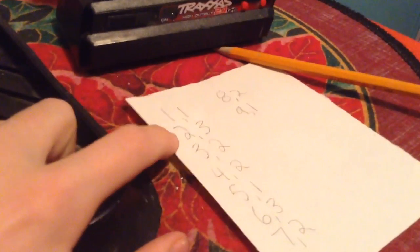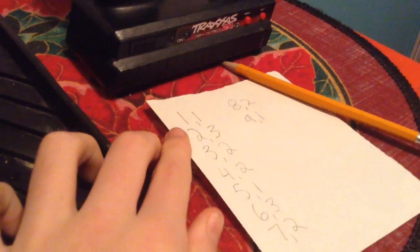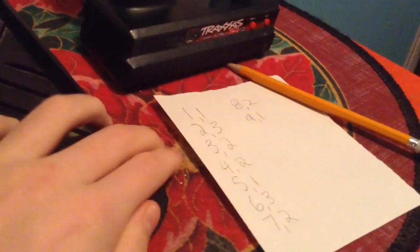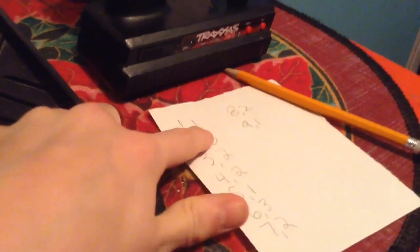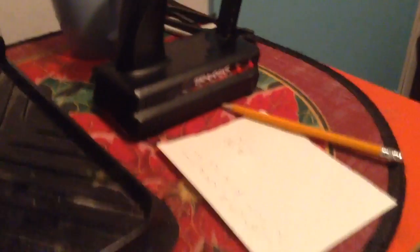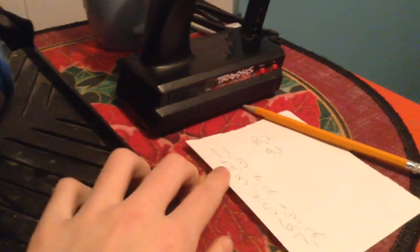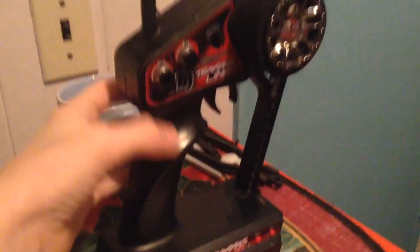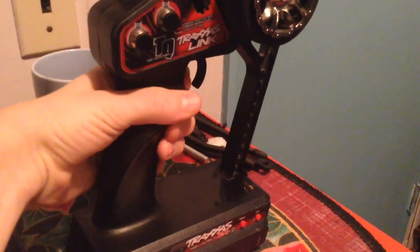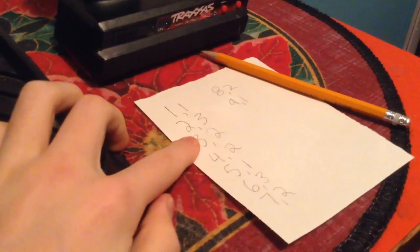But you want to get to the third option. So you're going to press no, and then it's going to pass over to two-two. So it'll go beep-beep-beep, pause, beep-beep-beep, and then it's just going to wait for your response. Then you're going to press no again, and it's going to go to two-three, which is what we want. Then we will press yes, because that is the setting we want. After that, it's going to pass to the third setting and first option.